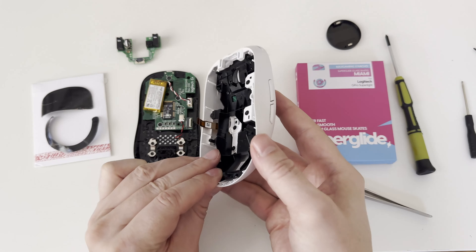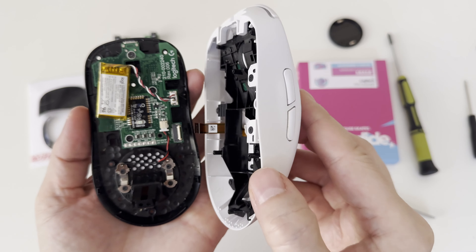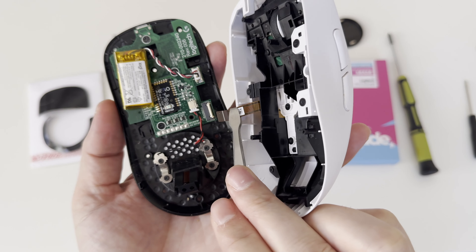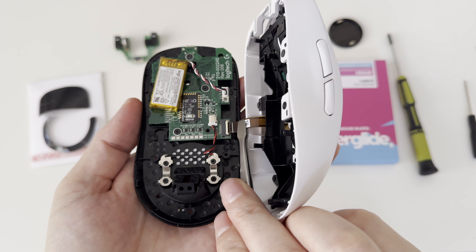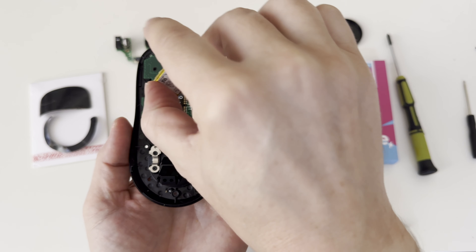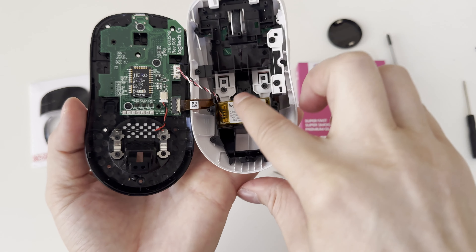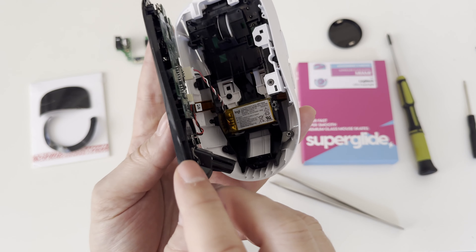These 4 screws together with the 6 screws under the feet is the reason why I chose to replace the switches board with a pre-installed board instead of the hot swap board — because every time I would want to change switches I would have to peel off and destroy the glider feet as well as unscrew 10 screws, then reassemble it and reinstall new feet. Now let me plug in the ultra-thin ribbon cable into the connector with the clip to connect the switches board with the main board. It is very important to lock the connector to ensure all contacts work properly. Now we can install the battery back — fortunately there are no screws for that and the glue is still present, so we can stick it back to the same place. This would also have to be dismantled when choosing the hot swap board and deciding to change the switches.